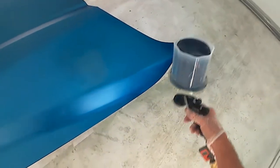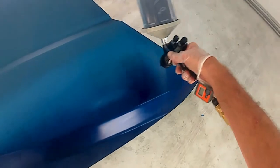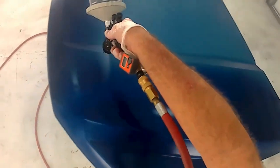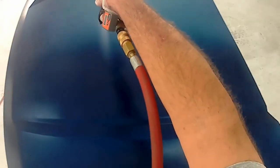Once the edges are covered and the primer spot is covered, apply your first coat of base coat. I'm using the Tecna Pro Light with the HV30 HVLP air cap and a 1.3 millimeter fluid tip. The air pressure for the first coat I've got set at about 15 PSI, just to get color on the panel.